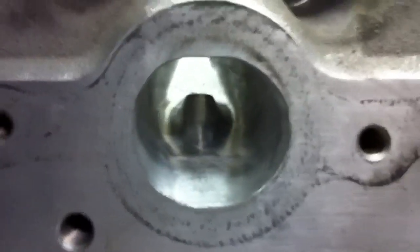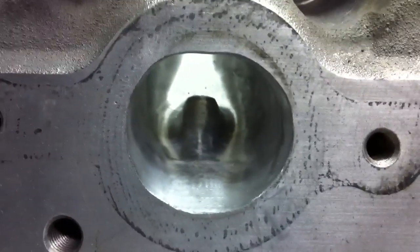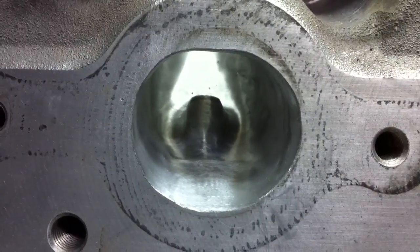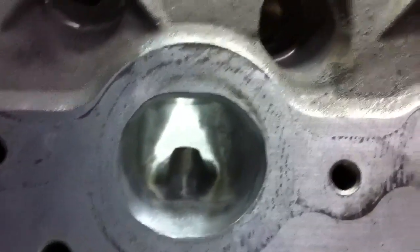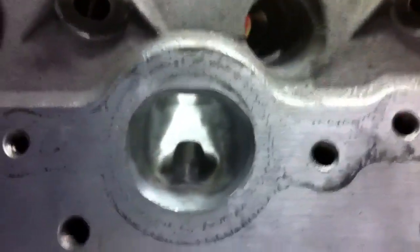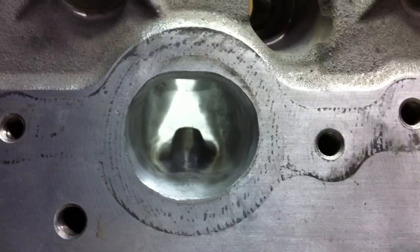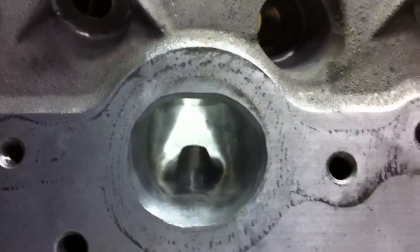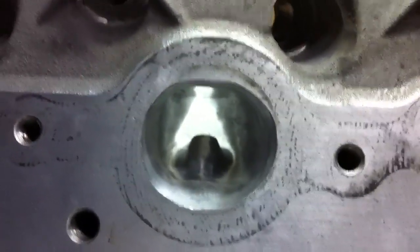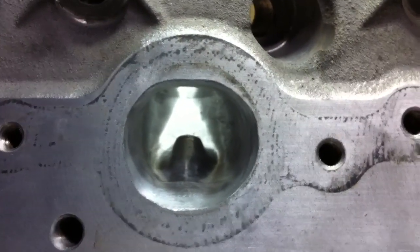For this truck this will be fine. I'll probably also open up the port a little bit larger for the 6.0, but this right here is going to be a great improvement over what's on it already — the flow will be greatly improved. This set of heads will not be flow tested; they're going straight onto the engine. I'll probably have dyno results to show the improvement. The next set I might possibly flow test. The first set I did flow test, which I showed in my first video, and you got those results — I expect the same from these.